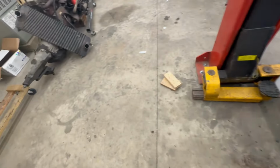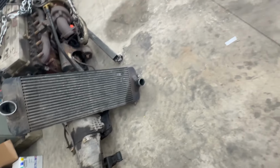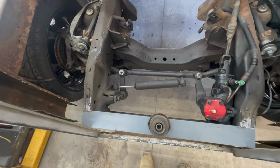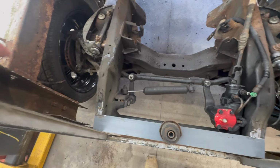And then the feet of the intercooler here, these guys here, I will drill some holes through the other piece that's going to saddle on top of this, and then it'll just stick right down through there. So that'll be where the bottom of the intercooler mounts, and then I'll have to make some mounts for the top.